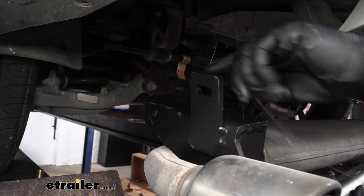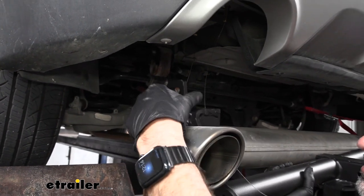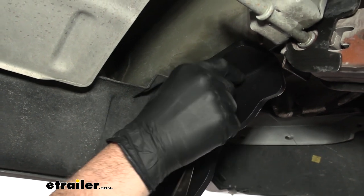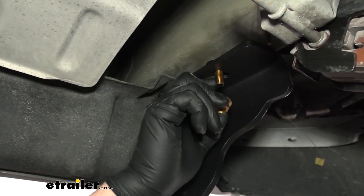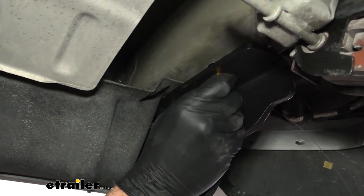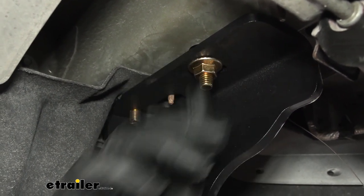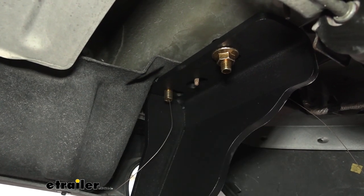And don't forget the side wire here, but remember the bolt we kept out. Go ahead and thread that through. Unthread the fish wire. And then carefully thread the serrated flange nut on. And that'll be enough to hold this side up. That way you can work over to the other side and just go ahead and secure all the hardware on both sides and snug it up.